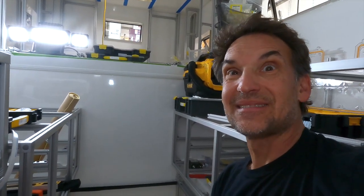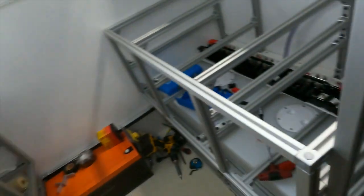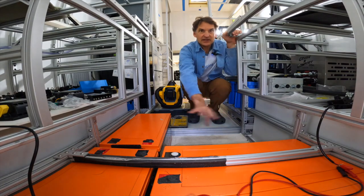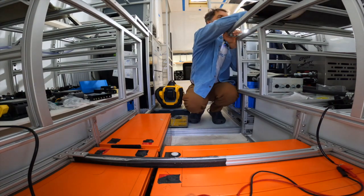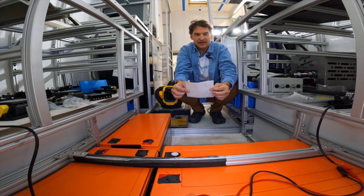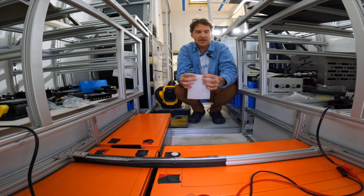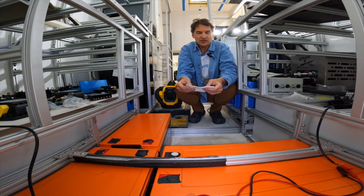Let's start installing batteries. The batteries are all lined up right here, ready to be installed, and I've got my mat down. I've cleaned out this floor, vacuumed everything out, and put down a siliconized rubber matting. The reason I put this down underneath the batteries is to give them just a little bit of cush — it has a little bit of give, only about an eighth of an inch thick, but it absorbs some of those harsher vibrations.